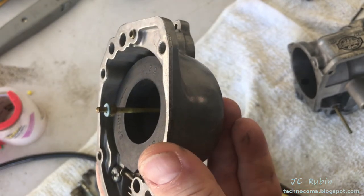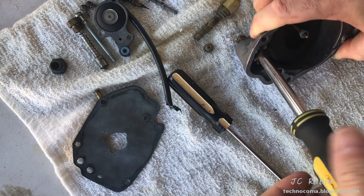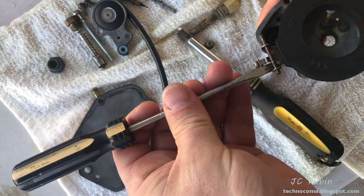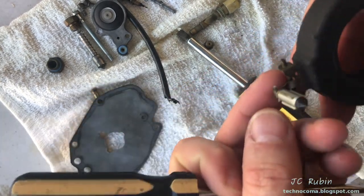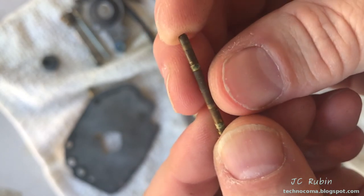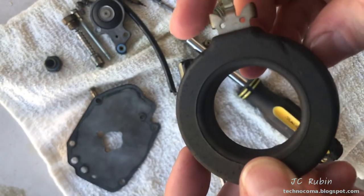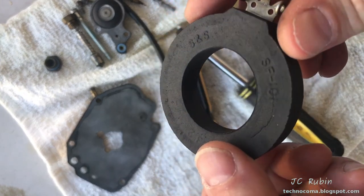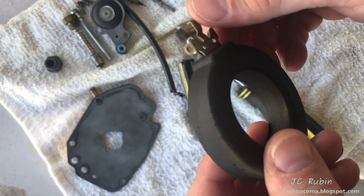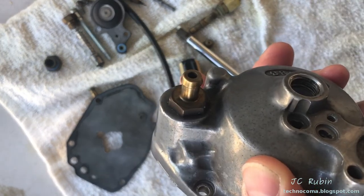That's bad — it's just stuck. We're going to take apart the pieces that hold together the float and the float needle. Looks like this needle has seen better days as well — that'll be replaced. This rod is covered with debris and will cause it to bind; this rod will have to be polished to a shine again or replaced. The float itself appears to be in good condition — it'll just be cleaned up and inspected for the height of the fuel level, readjusted if necessary. I'm going to remove this whole assembly from the carb using the 5/8.